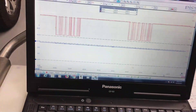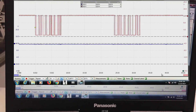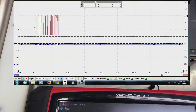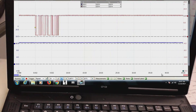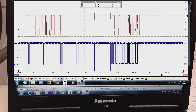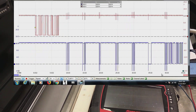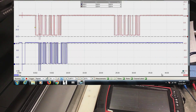This is different than the other ones we've looked at before. These rest at 12 volts and communicate by pulling down to zero. We have nothing on our channel A, which is our ISO — we actually have to go to the scan tool and talk to it to get it to start communicating. The airbag is the only thing on this network on this vehicle. We turn on the scan tool and try to communicate with it, and all of a sudden there's our data. I'm not going to ground out or put power on these — it's the same as the others and kind of redundant at this point, but they do function essentially the same when shorting to power and ground like the Chrysler and GM.